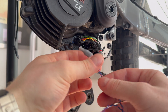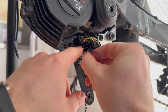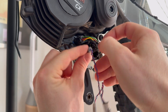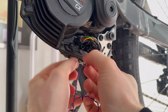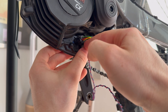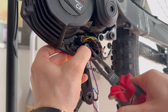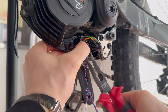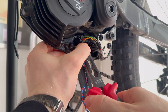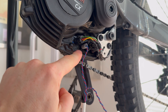Now we can power on the bike and check the activation. By default the tuning is active. If active, the display will show 20 kilometers per hour on startup. If not, you will need to activate it manually. To activate it, turn the bike on and pass the rear wheel magnet by the sensor three times. Just spin the wheel three or four rotations so the magnet passes the sensor three times. Then immediately turn the bike off — that permanently toggles the tuning.